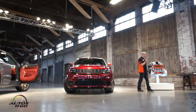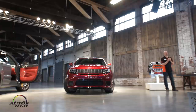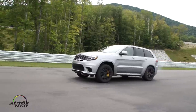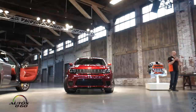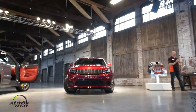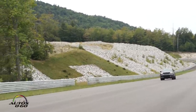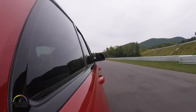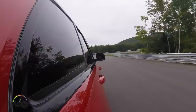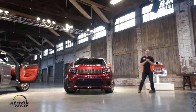Lastly, the QuadraTrac system has some unique settings. Typically, QuadraTrac is looking at various inputs from around the vehicle — throttle, yaw angle, rates, things like that — to predict when we expect to see wheel slip, and then it reacts. But that prediction and reaction all involves time delay. When we're at the drag strip about to launch, we know what's going to happen. So we lock up the transfer case and deliver as much torque to the front wheels as we possibly can. We also lock up the rear differential limited slip unit to essentially lock the rear wheels together and limit slip between them. That results in a 50-50 torque split front to rear and maximizes available traction.